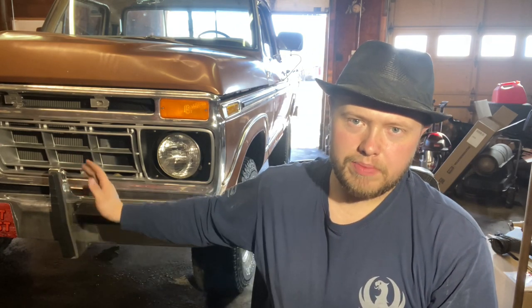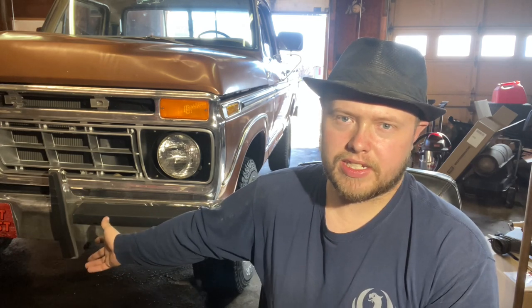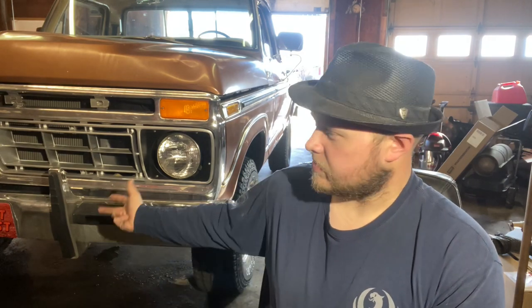Alright guys, that's it — we got it done. It does drive better; the steering's a little tighter and more responsive. I did notice the rag joint has some wear on it, so I'm going to get one of those and replace it. The tie rods are tight, the ball joints are tight — it was that pitman arm that was loose. The tracker bar bushings I already replaced; they're basically a panhard bar, real simple and easy. The rag joint's got some wear but other than that it's good, so I'll change the rag joint in a future video. If y'all like the video give me a thumbs up; if you're not subscribed consider subscribing. Thank y'all for watching and I'll see y'all in the next one — take care.